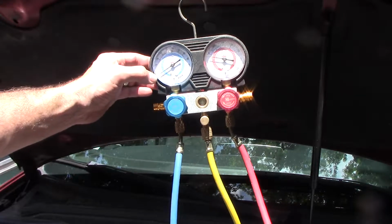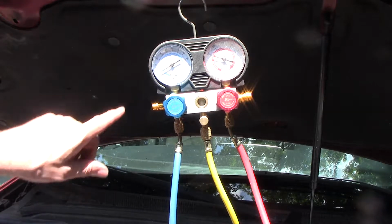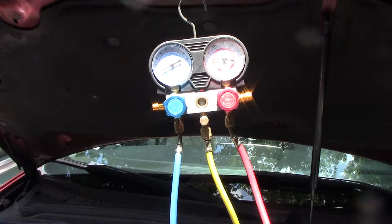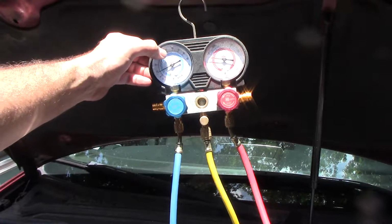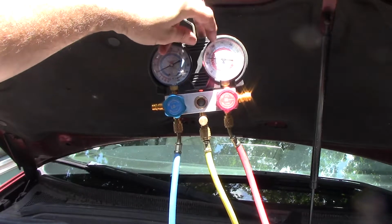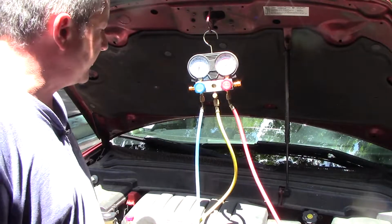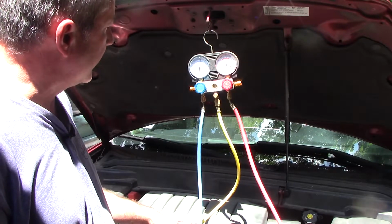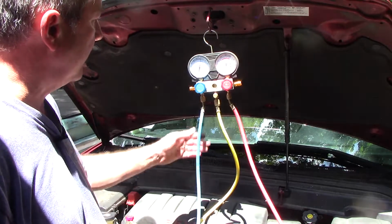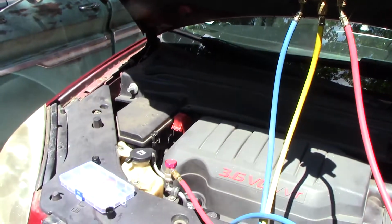So I started the car, and you will hear the compressor cycle, but we're clearly way low on charge. As I said, I would expect to be between 40 and 50 pounds on the low side, and the high side is going to be 200 maybe. I don't remember, I'm no expert. So the next step will be to remove what little bit of refrigerant is still in the system by whatever means you have available, and then we'll see what we can do to replace the valves, and we'll see if it'll hold a vacuum. The refrigerant has magically left the system, what little was in there.